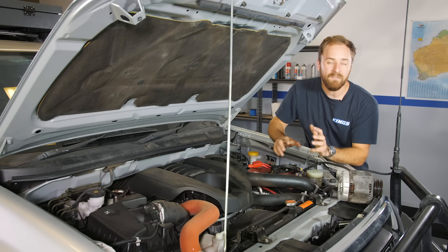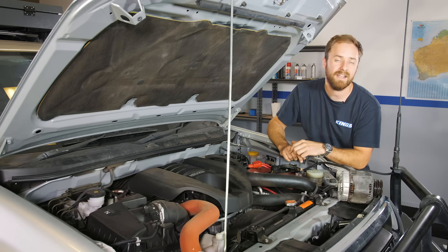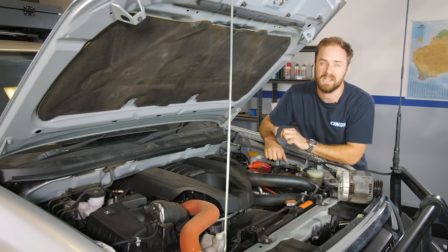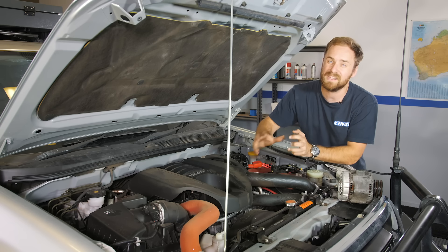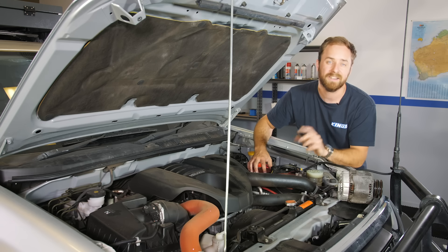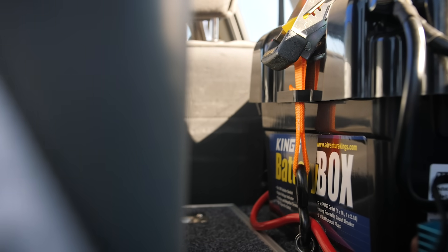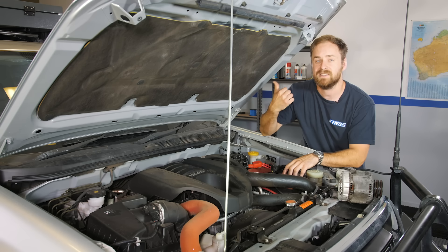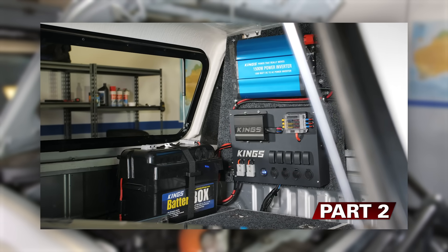In the mid-2000s, manufacturers started bringing out modern technology such as temperature-compensating alternators and smart alternators. Temperature-compensating alternators are able to read the ambient underbonnet temperature and adjust their charging to suit. Smart alternators can take it one step further, and as the battery approaches full charge, they'll turn off completely. That'll save fuel and reduce emissions, but it's not good news if you're trying to charge a dual battery system with a basic setup in the vehicle, because when the alternator stops charging the main battery, it'll disconnect the second battery and stop charging it too. Stay tuned for part two, where I'll show you the latest technology that solves these issues.